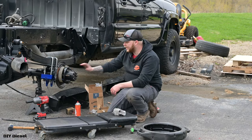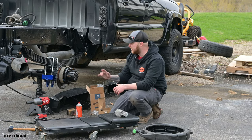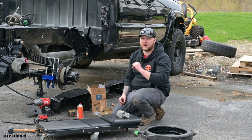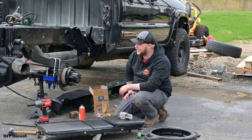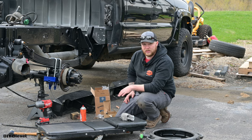And we're in business. Now, the torque spec on these bolts is gonna be 115 foot-pounds. You can replace these bolts if you want to, but it's not really a necessity. What's really crucial is that you torque them down to 115 foot-pounds. After that, you've got this fully back and assembled. You can go ahead and add new gear oil in, and then I do believe I run a 75W-90. AMSOIL is what I use.